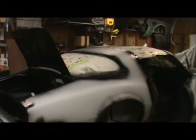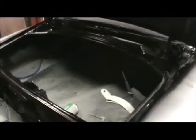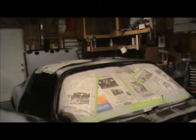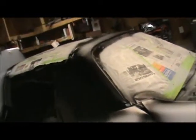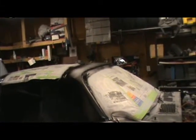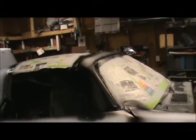Okay, we're a lot closer. I've jammed the entire car. The usual areas: trunk, bottom portions, around the wheel wells, doors, bottom of the rockers, bottom of the fenders, inner fenders. I've actually put a space in between the nose. Both sides have cracked it so I can get paint in the gaps. And now I'll hit it with some gray scuff pad when I get a chance, once it dries up a little bit, and then she'll be ready for paint.